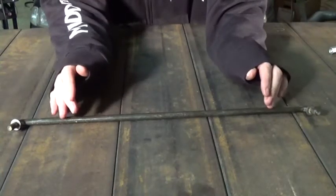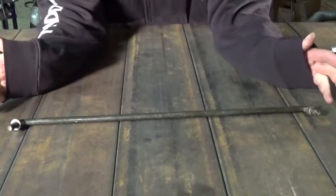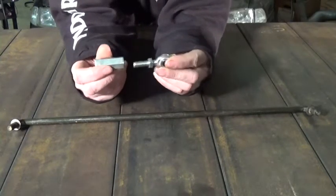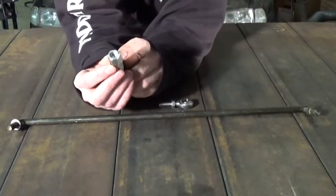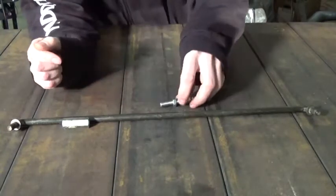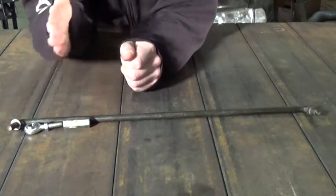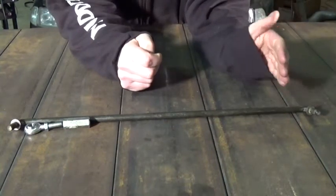The first option is to retain the stock tie rod. What I would do would be take this tie rod, hack these ends off — really just get rid of these nubs. Then go get two coupling nuts and two rod ends. The rod ends and the coupling nuts have to mesh together, so the threads have to line up. And you want one left-hand and one right-hand as well. Then take the coupling nuts, a third of the way down, modify the end so it can slide over the tie rod, then go ahead and weld that up. Then insert the rod ends and make sure you got jam nuts on there. Basically, you'll have a rod end with a jam nut and a coupling nut welded to the tie rod on each side.